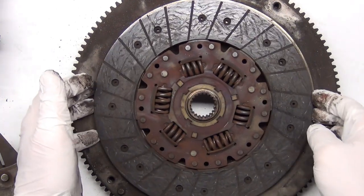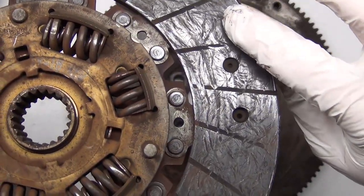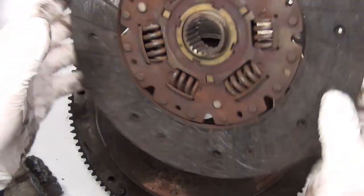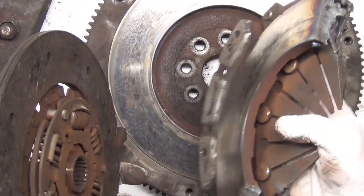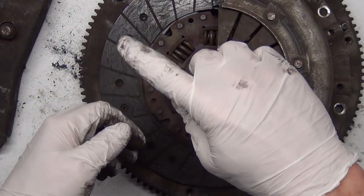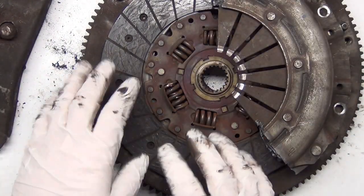This is the disc — this is normally the part that fails. See, this one's failed: you can see where the lines are gone and it's getting close to the rivets. It also has a little bit of a lip here, just like a brake rotor will get. It says brake pad material on both sides. It's got springs that help absorb some of the shock so that you don't stall the vehicle. But if the disc gets too thin, then the clamping force that comes from the springs and the pressure plate bolted onto the flywheel can't squeeze the disc well enough and it'll slip. What that feels like from the driver's seat is when you rev it up, the RPMs go up but the car doesn't move — you watch the speedometer going slow while the RPMs are high and the clutch is out. That's what a worn-out clutch disc looks like.